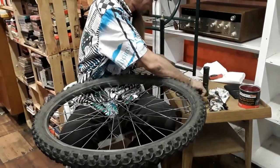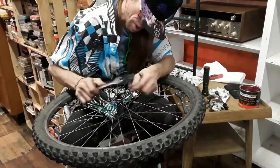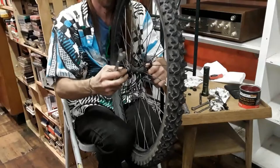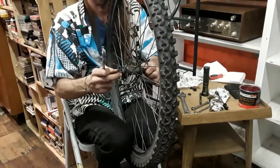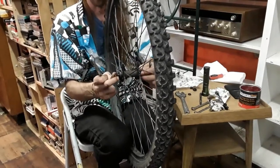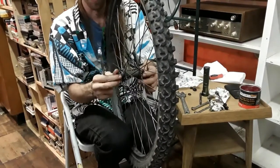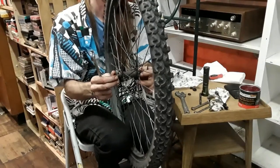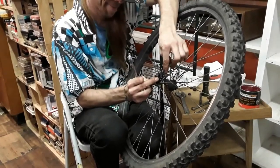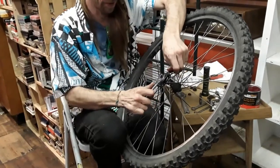So there's got it right here. Because I want a real thin half inch. Yeah, a super thin half inch. Now what I'm trying to do is, you don't want it sloppy, but you don't want it tight. So right there, that's pretty sloppy. You can hear that. So tighten it up just a little bit. No, a little bit more. It's not bad. Right there's too tight. So not bad is where we're going. Get real thin, half inch. Put 11/16 on the outside.